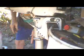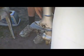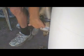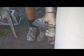And the water pump mechanisms are inside here. They would be hard to get to, but you could do it. This comes apart, pulls apart, and your water pump sits clear inside here somewhere, and your water pickup is right here, and it expels the water right there. So when you do get your motor running, first thing you want to do is make sure the water pump is pumping water through the motor, otherwise it will overheat.